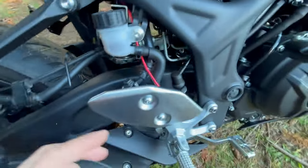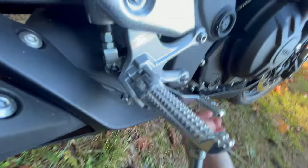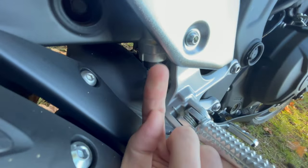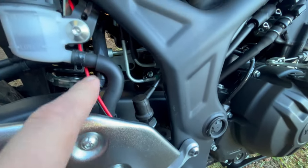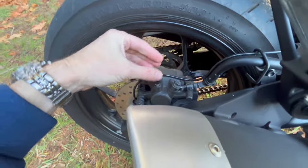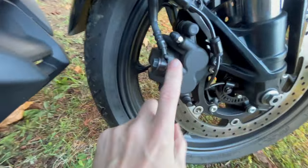You can see the clever bit inside here for the actuation. When this lever gets pressed down by your foot, it presses up on that connector which shoves the cylinder up here, displacing hydraulic fluid which goes into that line and then ends up going all the way back here to the caliper, where it forces the cylinders inside to press the pads against the disc. So that's a hydraulic brake.